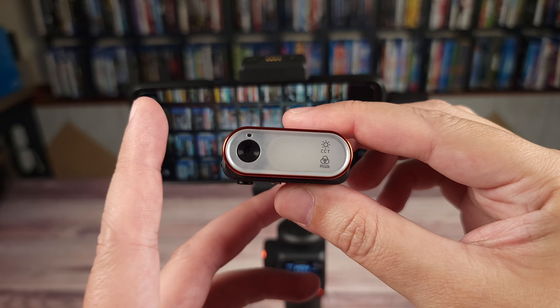This is also a RGBW fill light. I've turned it away right now because I don't want the light to blind the camera, but you simply hold down the button on the side to turn it on. Once it's on, you can turn the dial up and down to raise or lower the brightness, and if you press it one more time you can use the same dial to change the temperature as well. As you can see on the screen, it tells you the temperature and brightness readings, which makes it very easy to get a certain temperature or brightness you like. Lastly, if you click the same button three times it'll switch to RGB mode, and you just turn the wheel to get the exact color you want. I think most of the time I'll be using the white tones, but having the RGB there is great for achieving a certain look. Typically when lights have a white mode and an RGB mode, the white will be very bright and the color modes will be very washed out, but even on color this is still a very bright light.